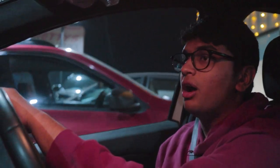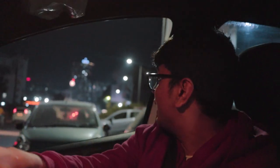We're just taking the Abarth out for a quick little test drive. Let's see if there are any immediate noticeable changes in performance. The new intake is making some fantastic noises and the throttle pedal feels a little bit more lively. The last one was suffering from a little bit of heat soak, and it was super dirty and damaged as well — it felt like it was not sucking in enough air at some times. This is a brand new one and throttle response has definitely improved by a little bit. Let's get on to a clearer road so I can open it up a little bit more.